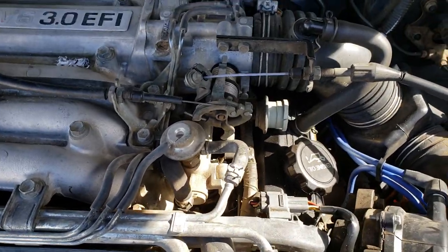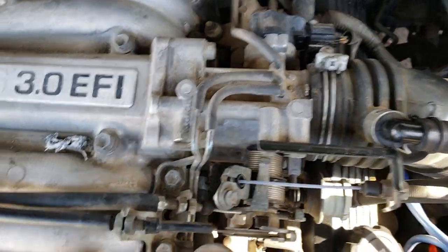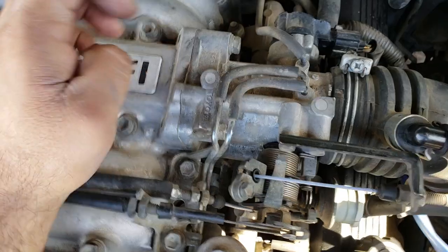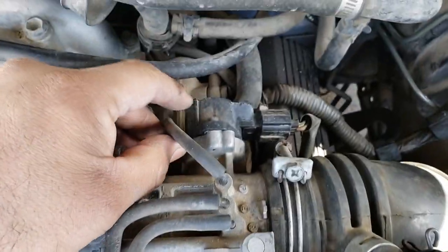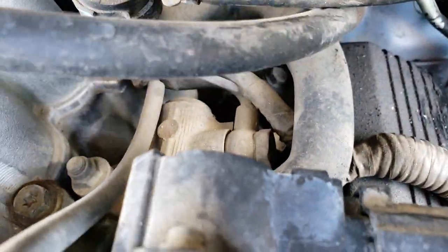And we've got, right here on top of the throttle body, two lines running here. These usually have stars on them for whatever reason. You gotta check all of these. I don't believe any of these that I have seen have any orifice in them, but it happens, guys. There's some that have orifices in there.